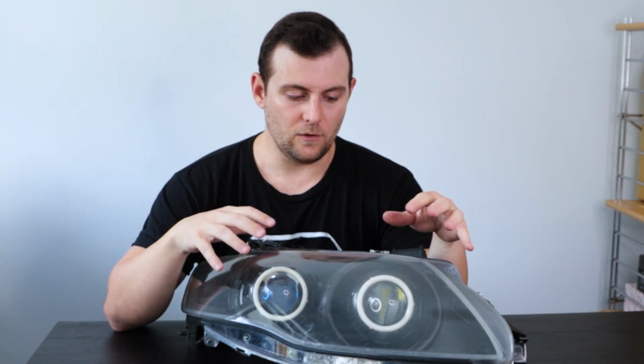retrofitting my headlights myself. So the first problem that you'll run into is these are not heat sealed. If you look up how to open up headlights on Google, you will find endless information on baking them or using heat guns to open them. None of that works with this. These are perma-sealed. Ford has done their absolute damnedest to make sure that you cannot modify or repair or do anything with your headlights yourself, and you have to buy a whole new headlight assembly.